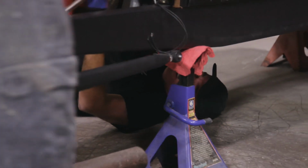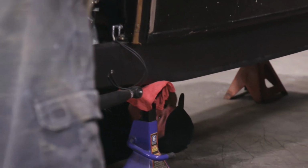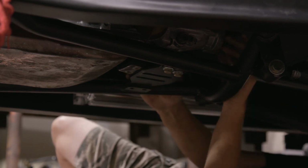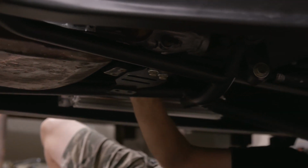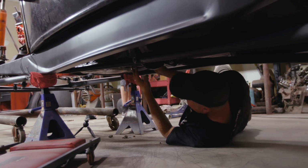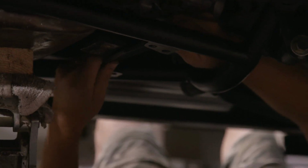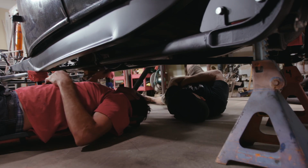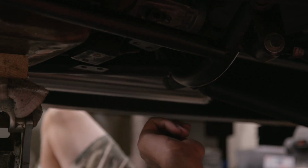Hold on, and all right, we're on the mount. We're also all over the floor, so. The issue I'm having here is that the transmission isn't clearing the floor, like the yoke won't even rotate. So we're gonna try and mess with this cross member here. That's sort of universal street roddy stuff to drop the tail of the transmission down so it's functional. Do you want to be totally butch and just use nuts for spacers? Yeah, go.